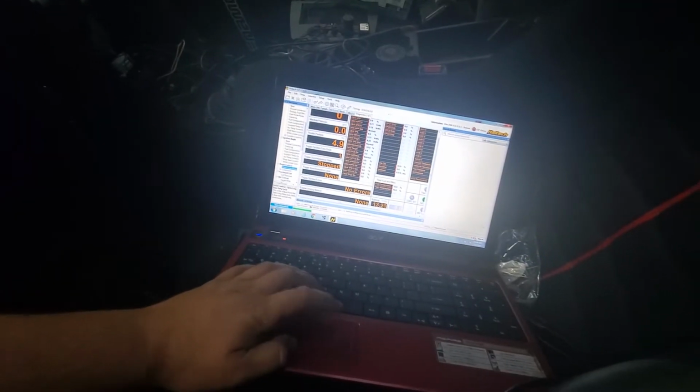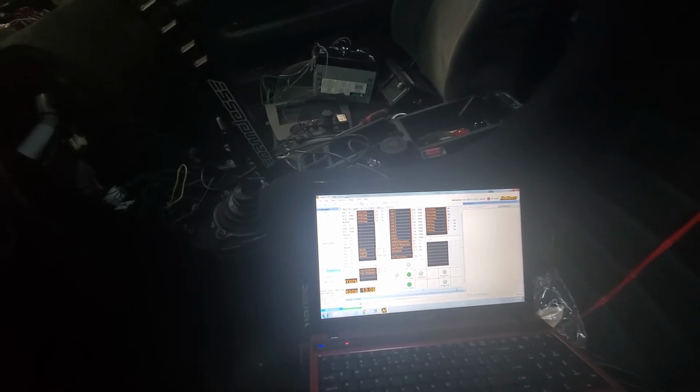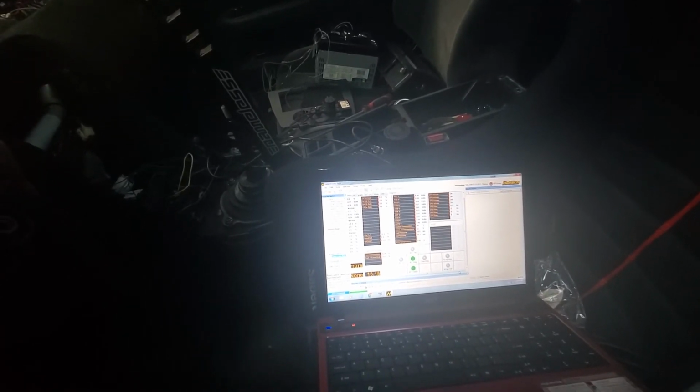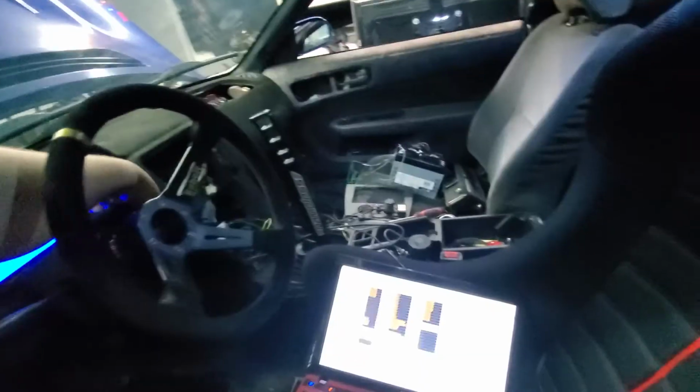Cool! So meanwhile, I thought I had a misfire due to the coil packs. This is why I love the Haltech. It tells you that it's got an open circuit on cylinder number 6. So now that that's cleared and it's connected again, now let's see how smooth it is. Okay. We're looking good. Oil pressure 60. We are good. All right. I can't breathe.